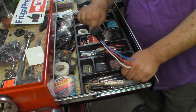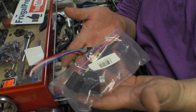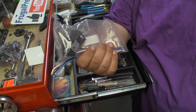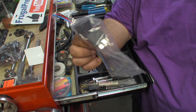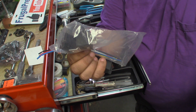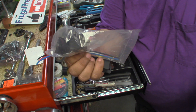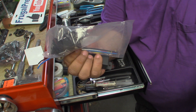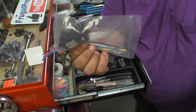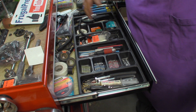I've got some relays — I keep a four-pin and a five-pin relay handy with the holder. I get these on eBay pretty cheap in a 10-pack or something; I've got more over in the cabinet. Mostly on Chryslers, if you've got a bad relay or a bad connection in the relay box, fuse holder, or on the TIPM — especially TIPMs — rather than telling somebody they've got to rip it out, replace it, and reprogram everything, we'll just pull the wires out, bypass that relay, and get it working — put the fuel pump on another relay or whatever.